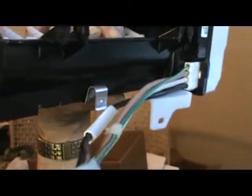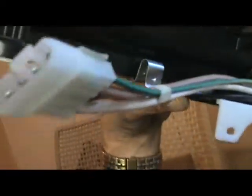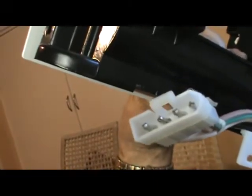See the difference here? See the harness? There's a plug that plugs into the back of the head of the ice maker. That box is the head of the ice maker — there's a plug. That's a modular ice maker — it's got a plug. And it doesn't matter what's on this end — this end is going to get changed to your five pin. So don't worry about what's on this end. One is open with four pins, another one has the prongs with four pins and different color wires. Another one has a connector that goes into the head of the ice maker, but the other end is round.